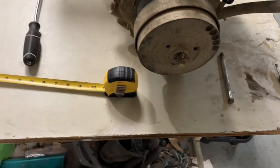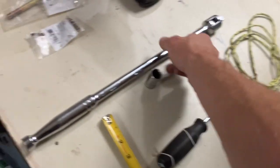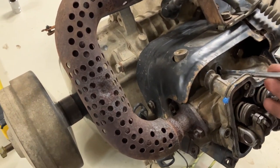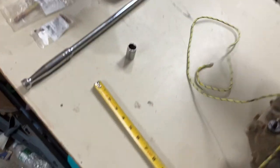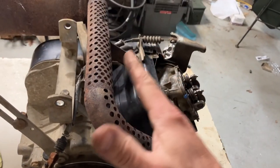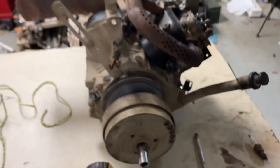Chances are it's going to be very tight. You may be able to do it with an impact driver, but most likely you'll need a breaker bar. To stop the cylinder from moving, turn it until the piston is at the bottom — you can check with a screwdriver inserted down there. Then take about six to seven feet of thick, hard string and shove it all the way into the cylinder. As you start screwing the bolt down, the cylinder will rise, press against the string, and the string will prevent it from going further. Now you can get your breaker bar on the bolt and start turning it. It popped off — it sounded like a gunshot — but it worked. And that's how you do it.